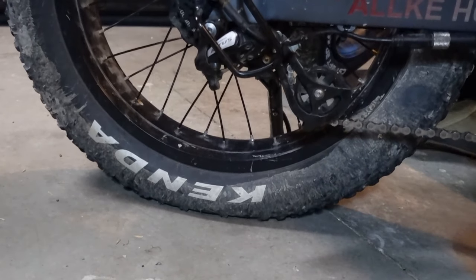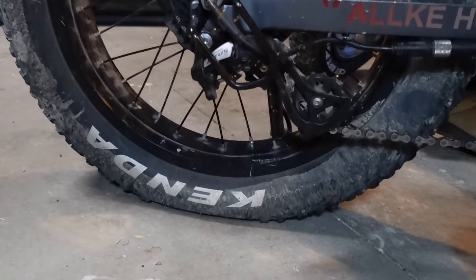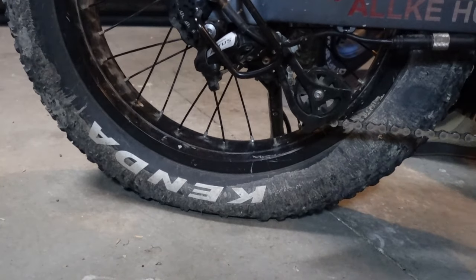The reason I pick on fat tires in this regard is that they go spongy a lot quicker than skinny tires, and a lot more often too. Now, low PSI is great in off-road situations and low speed situations, it's nice and cush. But if you're going fast with low air pressure, then you are making everything work harder. The battery efficiency and lifespan is gonna suffer big time.